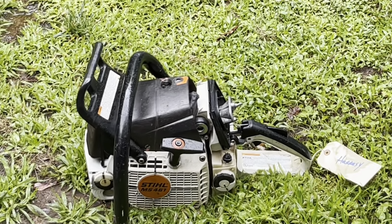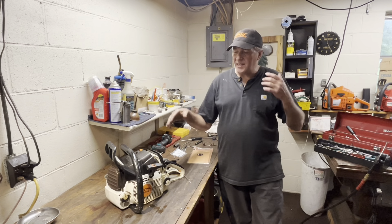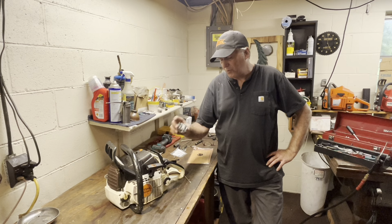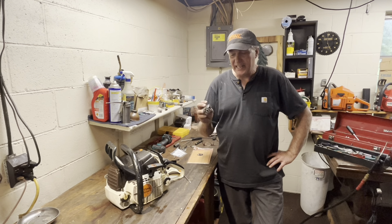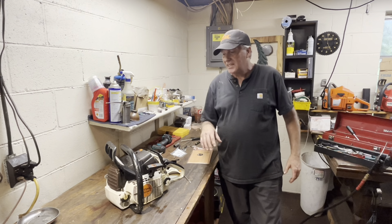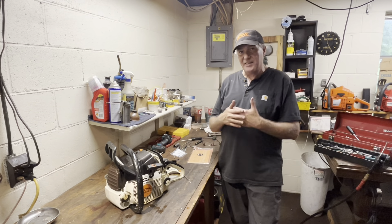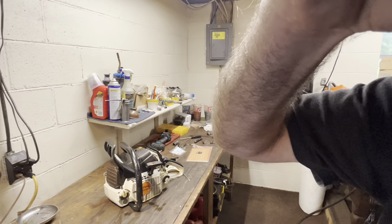Now she's alive, but there's a little more to the story. An extra hour of troubleshooting: when we went through this, the bearings weren't killed and the seals didn't look too terribly bad. The carb that came with this saw — I took it apart while working on the rebuild and inspected it. The diaphragm and gaskets were decent, not terribly worn or wrinkled. But I got everything back together and it just won't hold an idle — it would idle for about a minute and then all of a sudden start loading up and flooding for no reason at all while I was just doing a heat cycle outside.